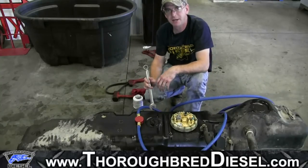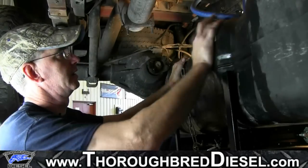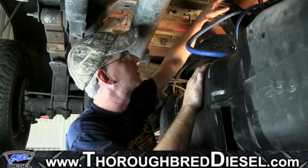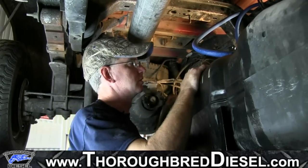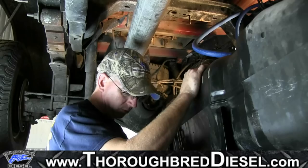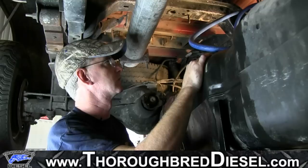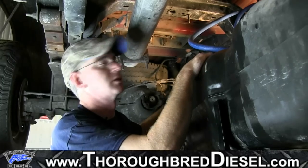Tighten both of these lines up and then we're going to get our tank back on the lift and start it back in the truck. We're going back up with the tank now. We've got our hose — that's all one piece — moved out between the frame and the bed right about where our stock hoses are going to hook up. Everything's going to hook up stock here — your stock lines, return, and pressure side all connect up. We'll electronically disable the old pump. I'm going to take it up so far until I can get to the electrical connectors and put my stock lines on.